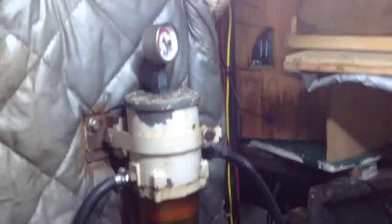Here's our engine room. Before we pulled the head off, we took all of the antifreeze out of the header tank and replaced it with water so we didn't have to worry about getting antifreeze all over the boat. We tried a number of things before ruling out the head gasket, like replacing the impeller and also the water pump, but then we realized the water pump was fine — it was running good and flowing good.